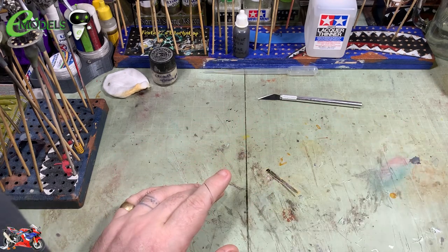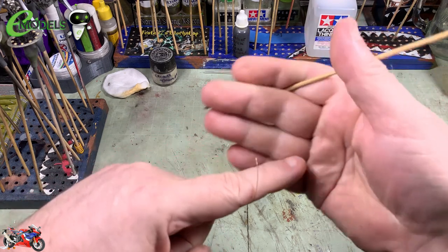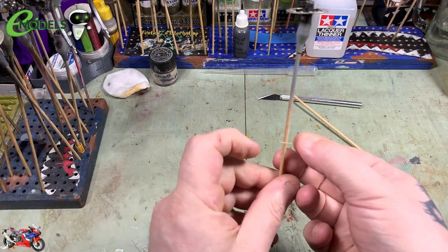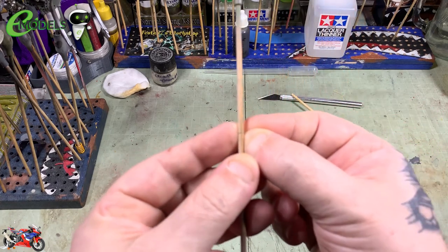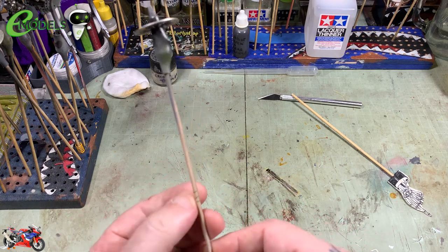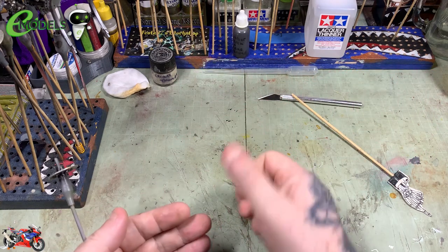So just press the scalpel in there like you normally would and run it along the length of the tape. Just flick a little bit off the edge. That will give you a nice little strip of tape — see, against my finger. It's a nice little parallel cut. Get the old pointy stick out — you should just be able to see it. This is the tape that we use to put against all the welds of the exhaust. It saves you a lot of time because we've all done it where you get wonky lines in your masking tape.